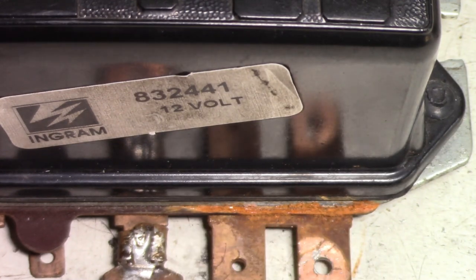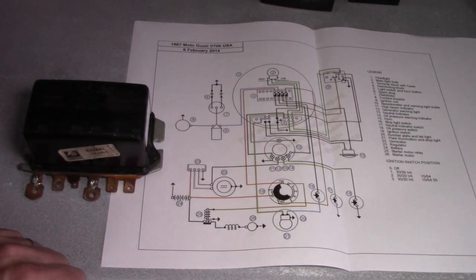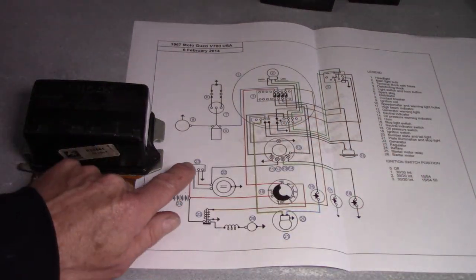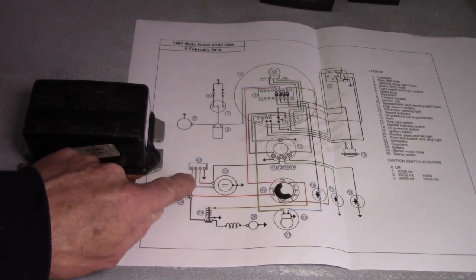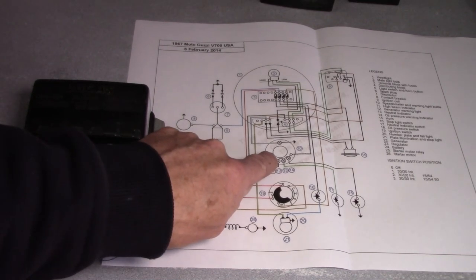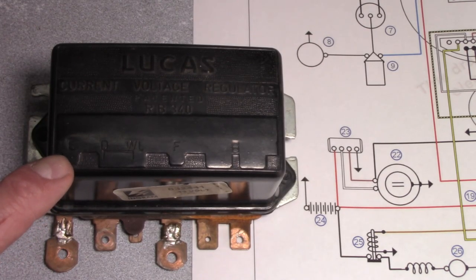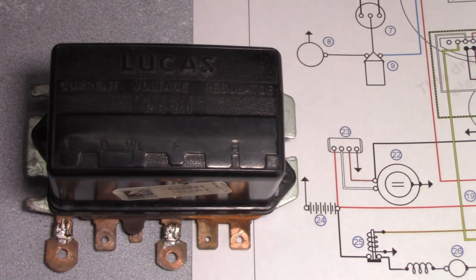I am a little bit concerned about this rust section. Figuring out how to wire up this regulator shouldn't be that difficult. I've got a good wiring diagram here including a legend down the side. If we have a look at number 23, it says that is our regulator. We've got a battery power supply over this side, our field winding over here, and a light which comes down and branches off parallel up to our dash warning light. And of course we've got an earth. If we look at our regulator we have earth, we have our light, we have our field, and we have our battery — basically reversed of what's on the diagram. So it really shouldn't be that hard. Let's head over to the generator, hook it up and see if this thing is regulating or not.